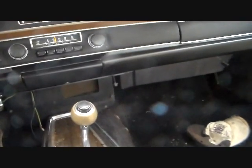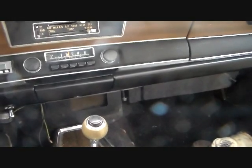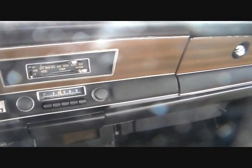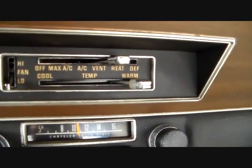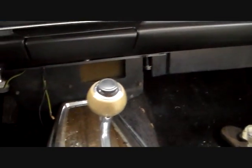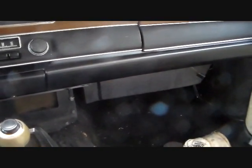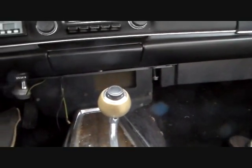If you have a non-AC car of any year from 67 through 76, meaning there's no factory air conditioning, you just have a car like my Plymouth out there, my green one. That even includes aftermarket air conditioning, where you have a unit hanging off the bottom. Same deal, that's considered a non-AC heater box. If you have a non-AC heater box, you absolutely have to take the box out. There's no way around it to get to the heater core. It has to come out.